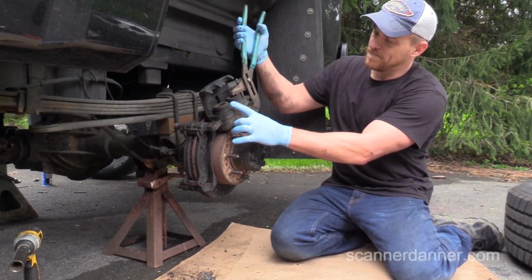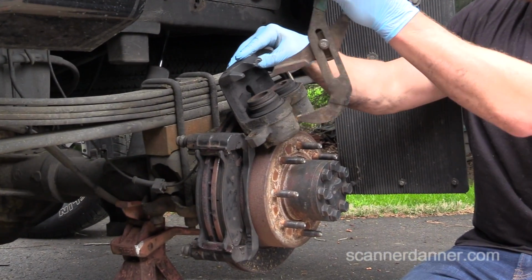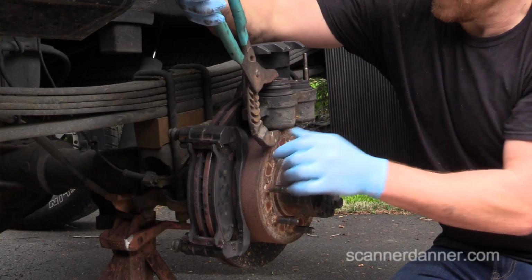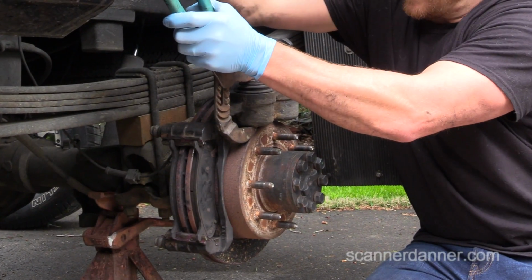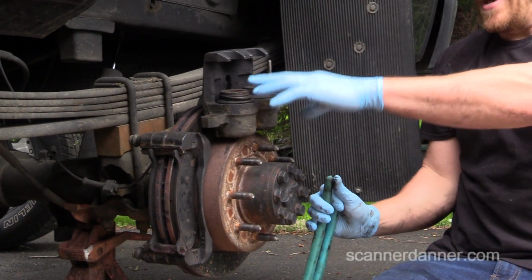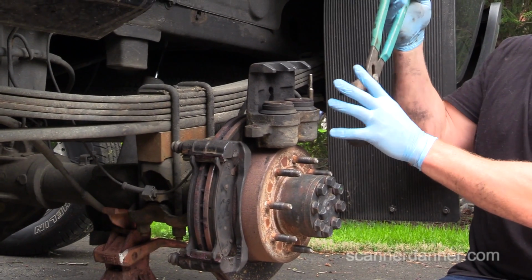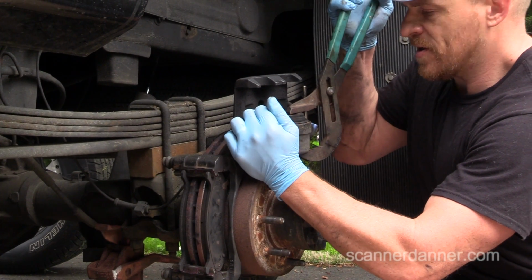All right, watch these pistons as I push these back in. That one. I don't know if you can see this side as I'm pushing this side. Let me get my hand out of the way. You'll watch this one move up as I'm pushing this one down. Right? That's really what you want to see, and that's why you want to use the pad to push these down together. I might be able to hold this by hand as I push this one in. If you go slow, you can do it.